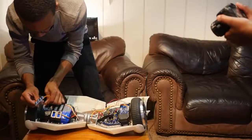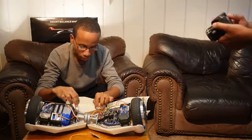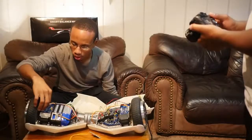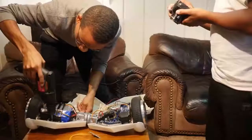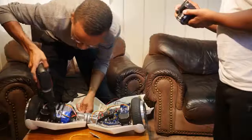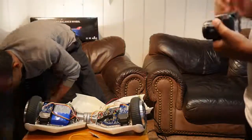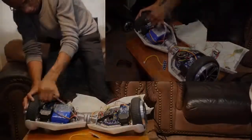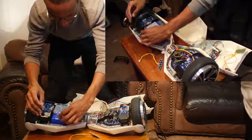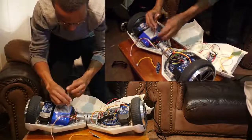Our lights fell off — you might need some glue to put it back together because some parts are going to fall off like this. We're on the battery side now. The speaker that we disconnected goes through the center — all the wires from the main board go through the center to the other side. This is the other activation pad. Let's take that bracket off, make some room so I can actually get to the battery cable, which is a yellow XT60. All XT60 connectors are yellow — typical on RC stuff. Usually Chinese RC stuff. Over in America they use Dean connectors. I just disconnected the status light and the activation switch light. This is the activation back to the main board.